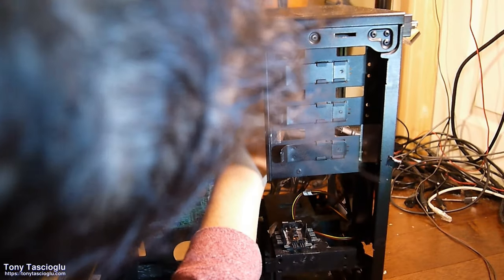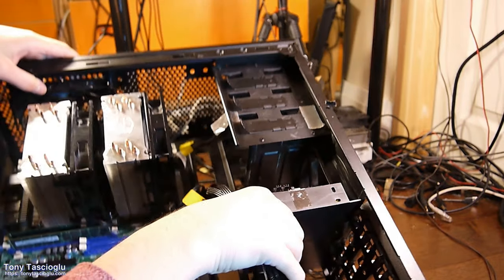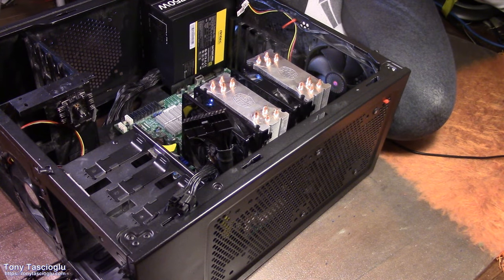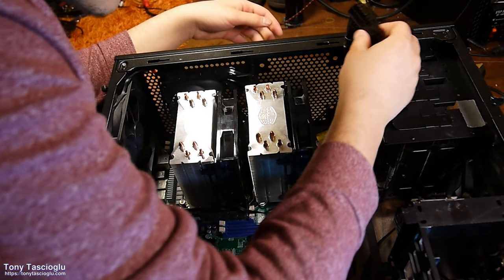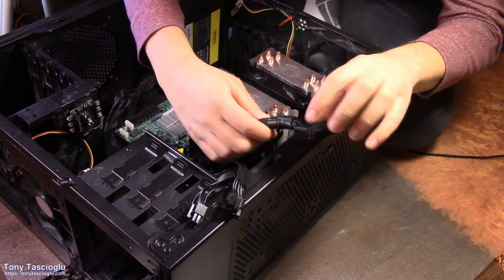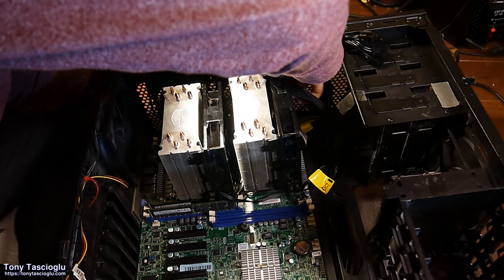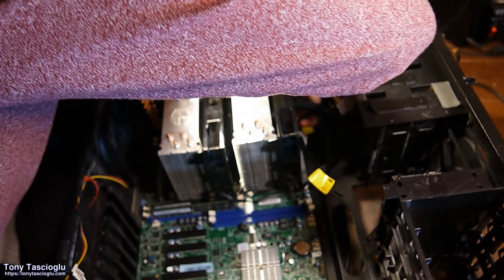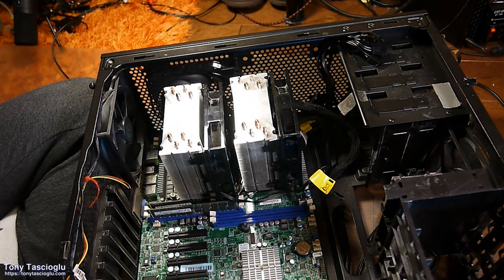These are the ones that gotta come from here. Alright, now we lay this flat again. Start with the 24 pin because that is the challenging one. Alright, so this has the clip I can see at the bottom, so we want it facing this way. All right, I heard the click. That is excellent.